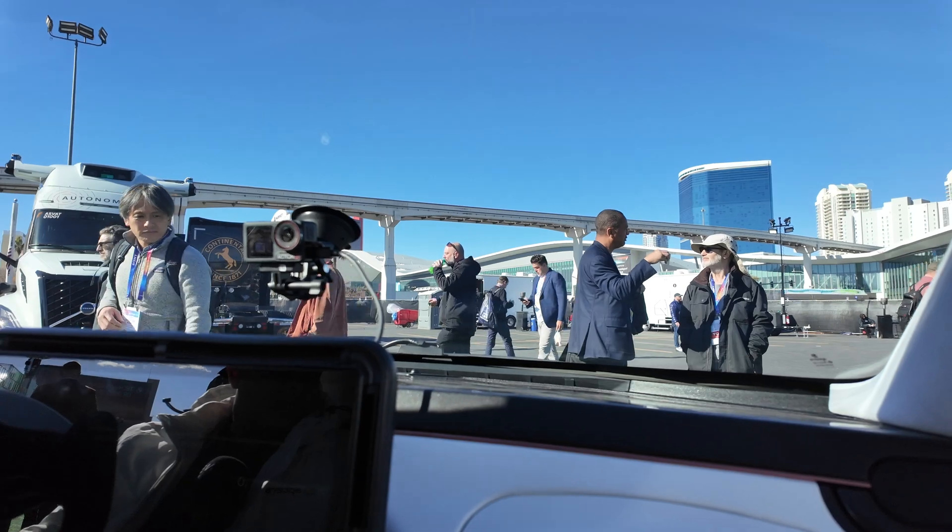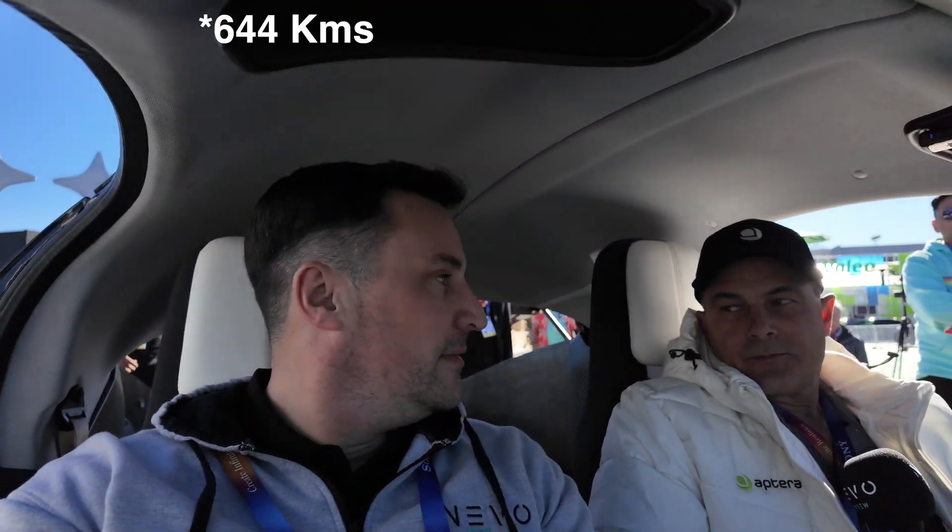Range-wise, 400 miles is the expected range. Because it's so light and so aerodynamic, it's approximately half the battery size of something like a Model S and achieves the same range. You're taking away additional weight and an extra wheel, and the aerodynamic drag is profoundly lower. The overall weight of the vehicle is approximately a ton — 2,000 pounds.